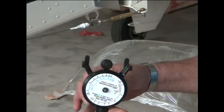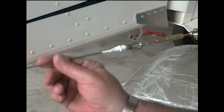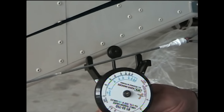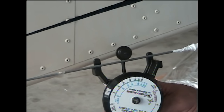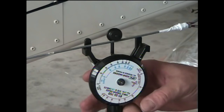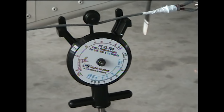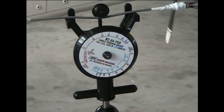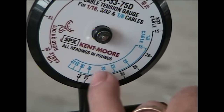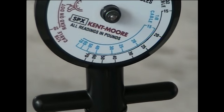I'll show you how it works. Here's the cable — I don't know how tight this is, it might be 30, it might be 35 pounds. All you do is put that behind the cable, connect this to the top, put it on the sides, and now that's your cable tension. Reading from the indicator, you have to interpolate between the 30 and the 40, but this says that it's about 32 pounds.